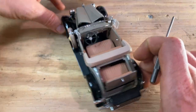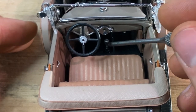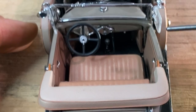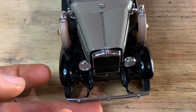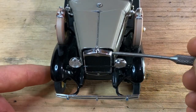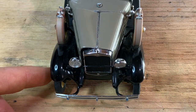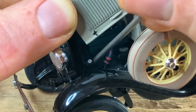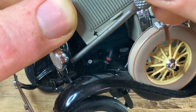In general, the first thing you're going to do is remove the control linkages — the shifter, the e-brake, the choke rod, the starter — all of that has to come out. You'll have to take the floorboards out to do that. Then you come around to the front, remove the bumper, the headlight bar, and then the hood, and then the radiator and the water line. Once you've done that, go ahead and remove the starter and the generator and disconnect the wiring and pull that out.